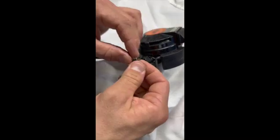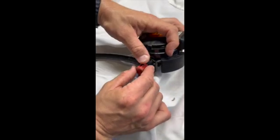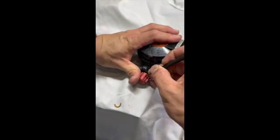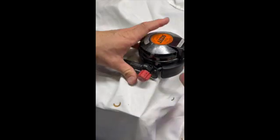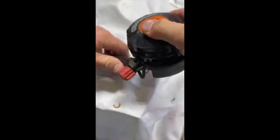After that, I get my roll pin and start it. Be careful pushing this with your finger because it could penetrate your skin. Then I just push it in enough to make it flush. No more leak. Thanks for watching.